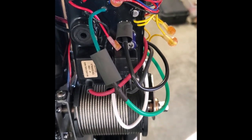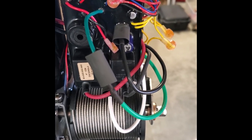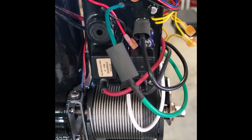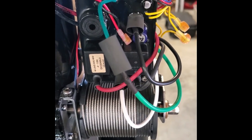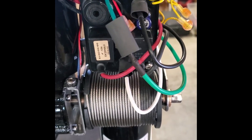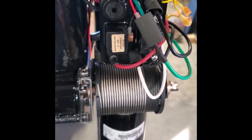We've got all the wires disconnected. Now we have all the wires connected and we've slid the heat shrink into the right positions. Make sure to put the heat shrink on before you make all your connections. Now we'll use a heat gun, heat them up, and shrink them right down.